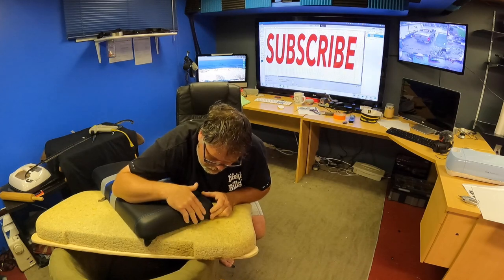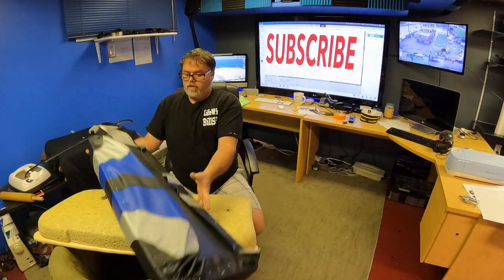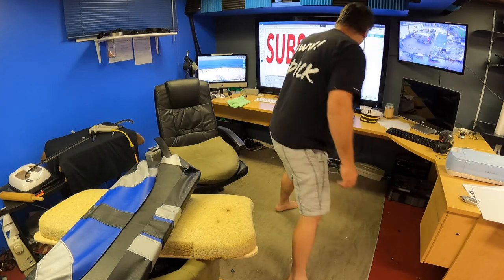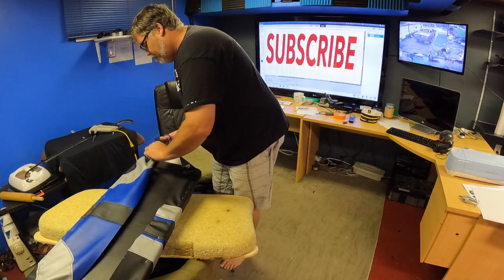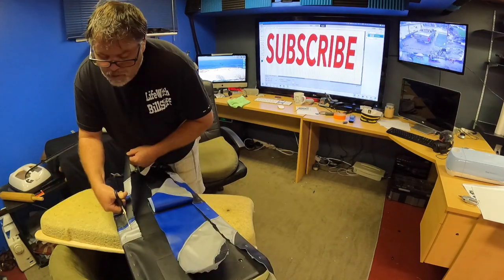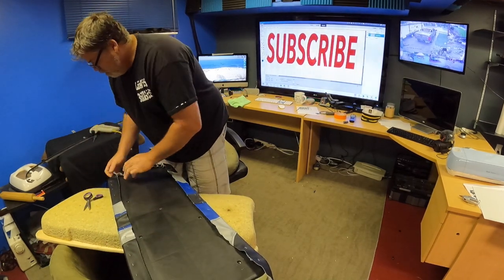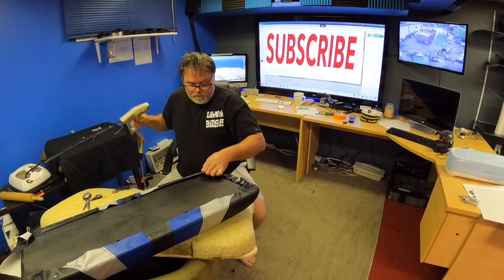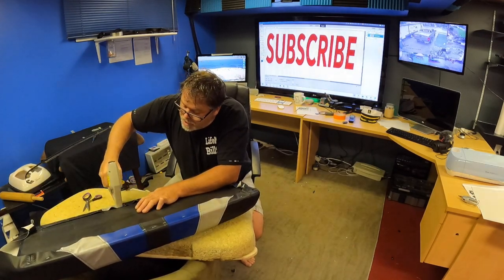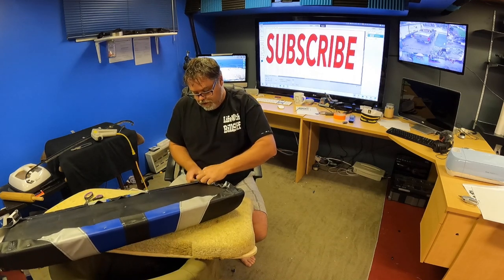As you can see we got it pretty good. There's a couple little marks where it's stretched but we'll work them out with a little rubbing and tugging — just kind of rub it around and then add a little bit of heat. Leave your comments down below and let me know what you think. So let's just do this back side and I'm going to get a razor blade or scissors and cut off some of this excess material. That's another reason why I might be getting some creasing — we got a lot of extra material here so let's get rid of it and it'll relieve some pressure. The only problem is the vinyl is going to want to separate now where the staples were or where the seams are, so make sure you really get the seams so it can't come apart. Staples are cheap — use them.